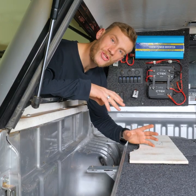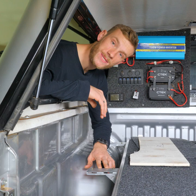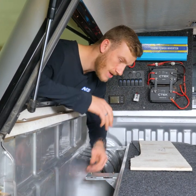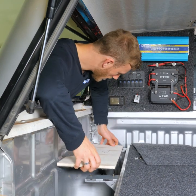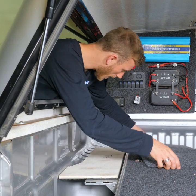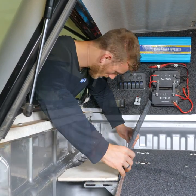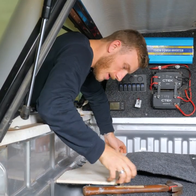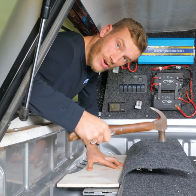Once you're happy with the shape of your wing, you can measure out the spacing for your bolt holes. What I prefer to do is put the bolts through from the bottom, grab your wing, place it on top, and allow for carpet. Then grab a hammer, make sure it's all square, and give each corner a light tap.